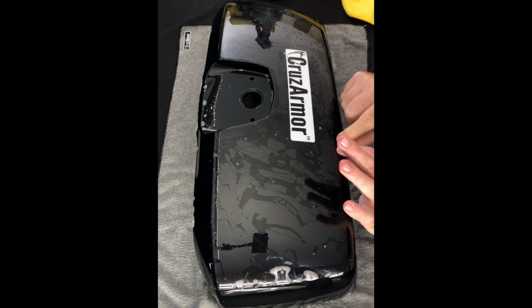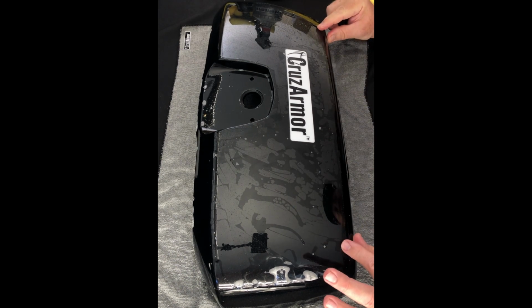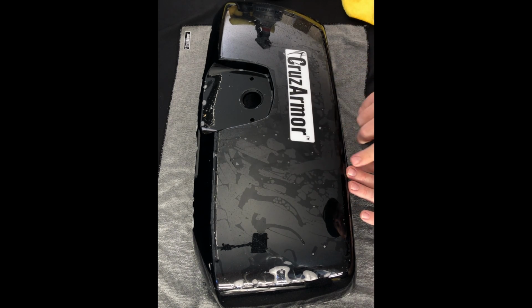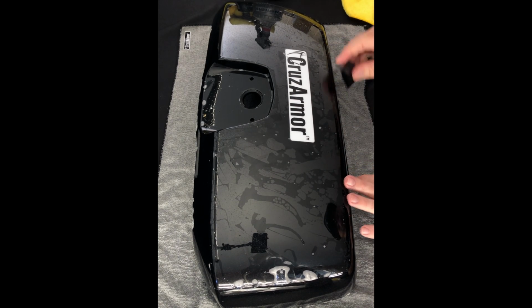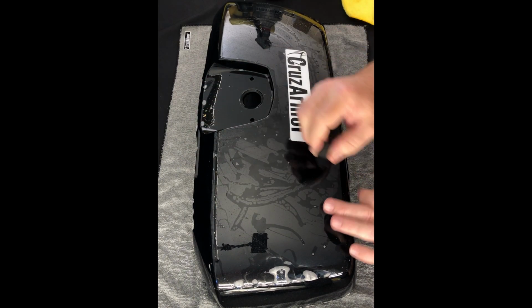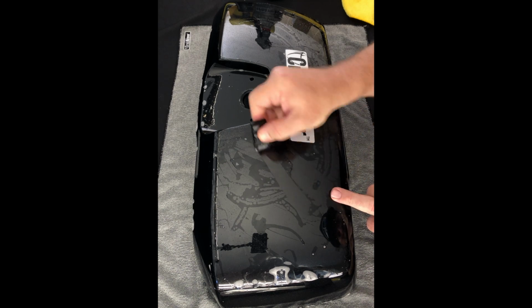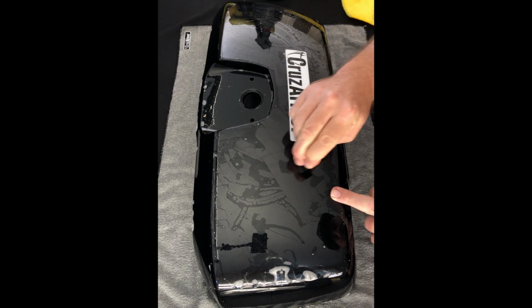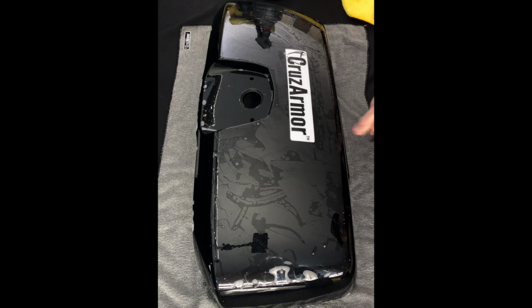Now the thing with the alcohol, since I sprayed here, it's anchored, it's locked down. So if you had a bubble or a liquid bubble out here, you can't chase it through the wall, so to speak. We haven't used any alcohol underneath in this section, so I'd be safer if you found some liquid bubble to work it out this way versus coming out this side.